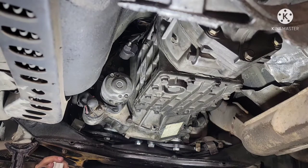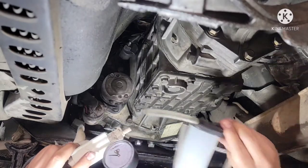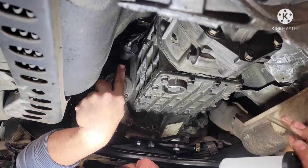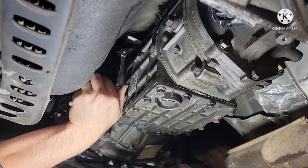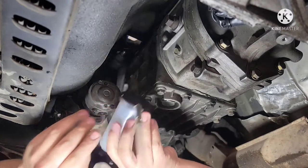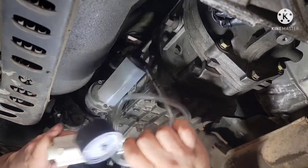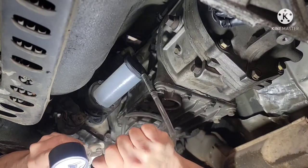Underneath the vehicle we're going to bleed the clutch. What I've got here is a manual vacuum pump — we're going to vacuum-pump this air out and then it should be ready to go. We're going to crack that 8mm bleeder screw open, put that clear hose in, and bleed this thing out. The nice thing about this is you don't need two people; you don't need to open and close the valve.